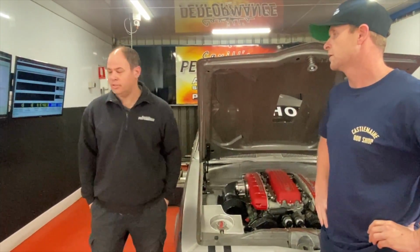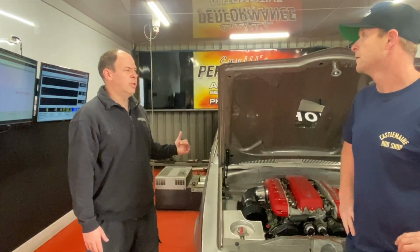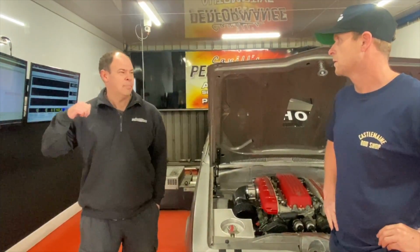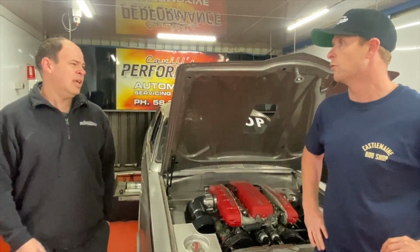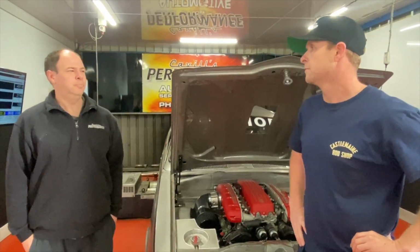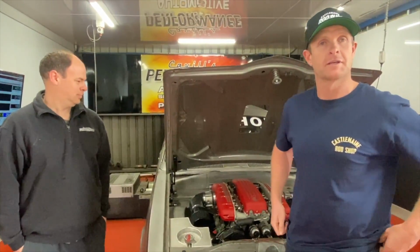So that is definitely in line with that. If you take it out through a converter, you've got a 20 to 25% loss. Through your converter and your diff and all that. So if we work that backwards, with 25% loss, it's about 560. So we're in the ballpark, if not making a little tiny bit more. On paper we're making a little bit more, but who knows unless you actually engine dynoed it. So, bragging rights, it's maybe got a little bit more power. Joking. So everyone goes, what's next? I want to get on the street, cut some laps, and see if we can get pulled over.